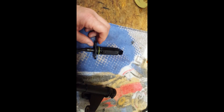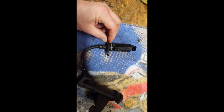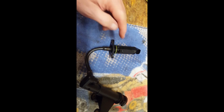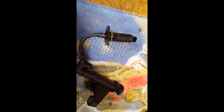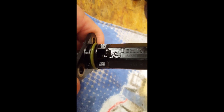One of the other things I did was think, well, it must be the o-ring — this o-ring here on the oil pressure sensor that had gone bad — so I replaced that. It still continued to leak. Till finally I said, you know what, I'm just going to change out the entire sensor and see what happens.